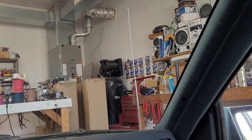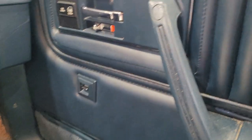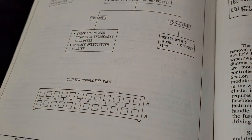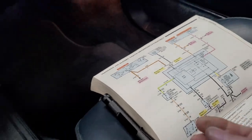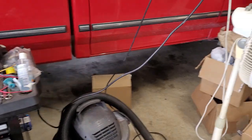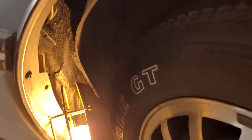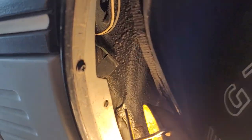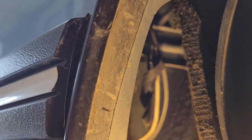I also wanted to look into the power antenna. I got it straightened up — it's straight as an arrow now. I looked at the wiring diagram and checked the fuses first since it's not making any noise whatsoever. To show you what I found, there's a little access panel behind the front wheel held in by a couple of clips and some 7mm screws. When I got in there to see if someone had unplugged it, instead I found they had cut the green wire and taped off both ends.